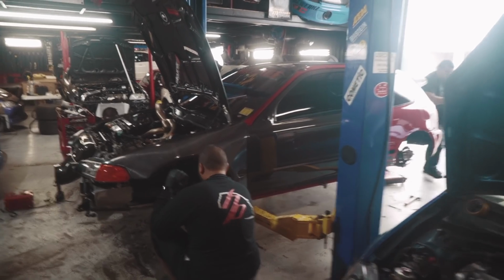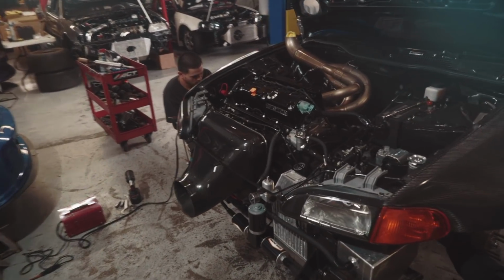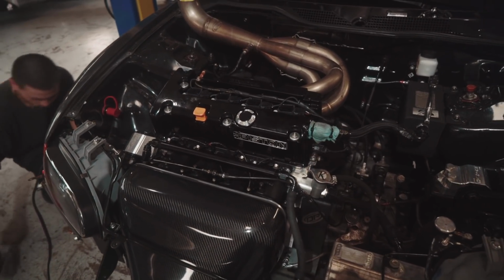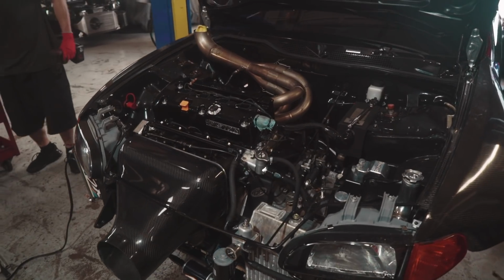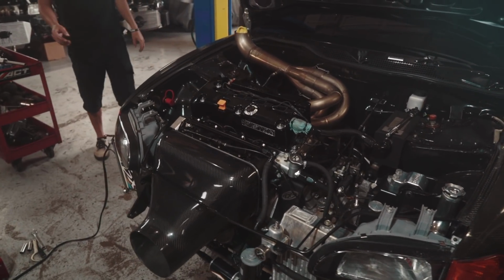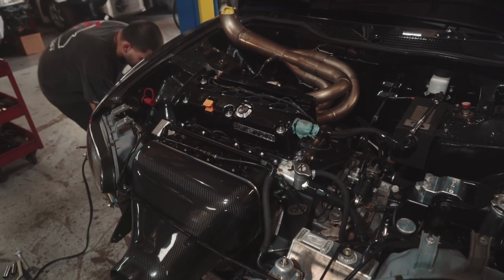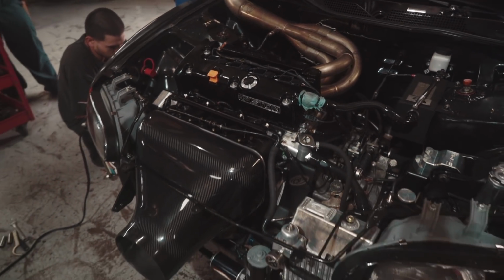This motor, to recap for you guys if you don't remember, is a Super 99 four piston engine. Super 99 means that it uses the stock TSX crank that is a 99 millimeter stroke, whereas Alex's car, the Bolo's car, is a 106 millimeter, so it has a custom billet crank. This is an OEM crank that you can find out of a TSX, custom rods and pistons, all that stuff. So this is a Super 99 engine. This is considered the budget all motor engine.